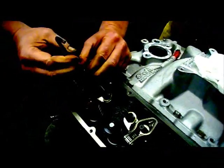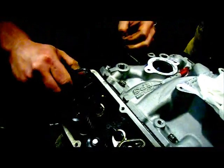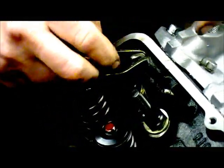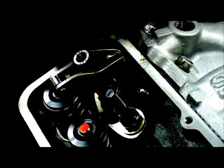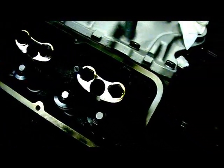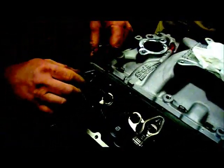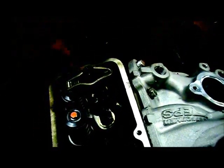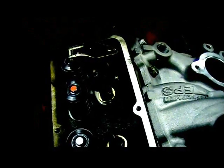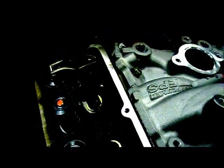Obviously we're gonna have to make an adjustment. I did not put these washers under these — another machine shop did that. Just so y'all know, that is wrong. Now we've got our rocker set just at zero lash, just touching. We're gonna make two complete revolutions. This is a good time to check for coil bind and all that other stuff you should have already checked for, and just to make sure your rockers are clearing and not rubbing in the radius of the stud.